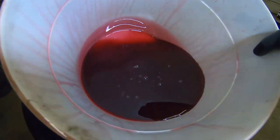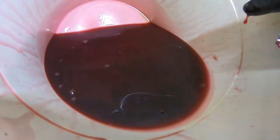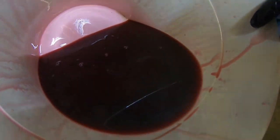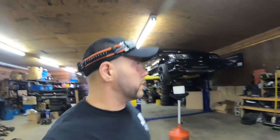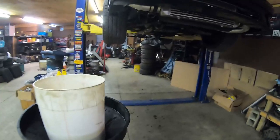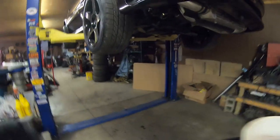All right, so you can kind of see the silver hue in it — that's from the synchronizers. You can see a little bit of sparkles. Yeah, guys, that's normal fluid — that's not terrible at all. I expected it to be a little bit worse than that, but it wasn't. So we're simply going to put you on a little time lapse and zip three quarts of synchromesh fluid in it, and then we'll talk about it in a second.